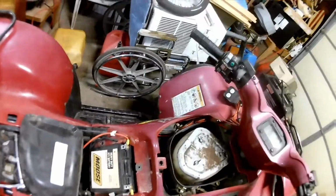Upon further inspection, right down in there, there's a nut missing that's supposed to hold the cage that holds the screws that go down through for the air cleaner. There's supposed to be four. There's only three in here. There's two bolts that hold the whole air box in, and the front one there is not even tight. It's in there, but it's not cinched down to the rubber that's supposed to be the dampener for that, among other things.